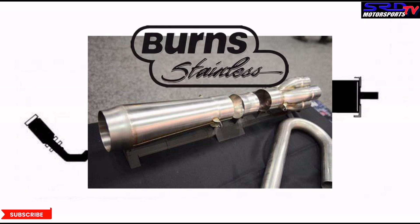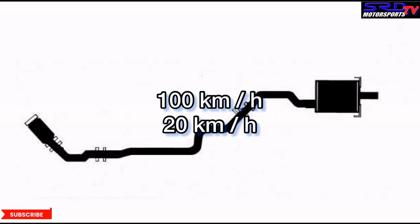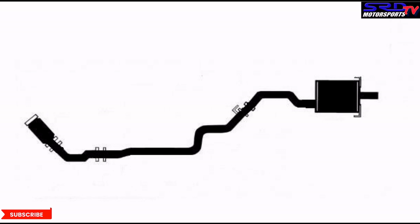It's only Burns Stainless in the US that manages to do this consistently — this is why all the known headers run that. And when I said it just makes more noise, my Puerto Rican friends would laugh at this. We call it 'ciento vente' — you sound like you're running a hundred but technically you're running 20 kilometers per hour. It sounds loud and fast, but is slow. Now visualize this: the exhaust flow starts from the beginning and keeps flowing. You can see the length actually helps scavenge better, especially with a good muffler. As the exhaust comes out, it pulls the incoming exhaust from the header — they connect and it makes it scavenge better.